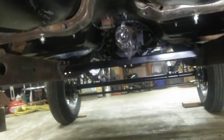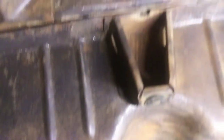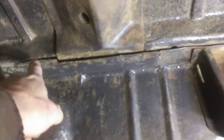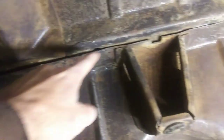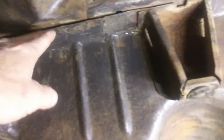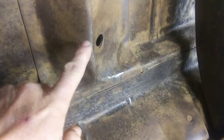Get it all looking good, all the way down there. Straight axle - gotta like that. So that trunk pan right there - the spot welds are busted apart. I'm gonna go up inside the back seat, put some self-tapping screws and suck this back together, then spot weld it - probably from the bottom since there's not much room up inside. It's cracked right there a little bit, but it won't be structural anymore - I won't be relying on it being strong to hold those shocks.